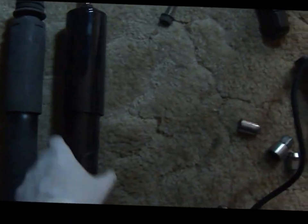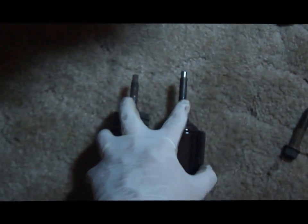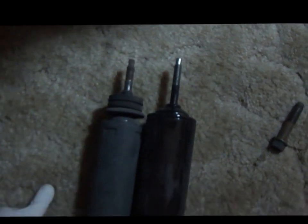As you can see, the new shocks seem to be a little different — actually they're a little bigger, a little thicker I should say, and that's probably a good thing. The main thing is that fully expanded they appear to be of the same length, the bolt position at the bottom is the same, and the threaded parts on top are on the same level — so that's what's important.